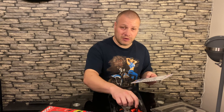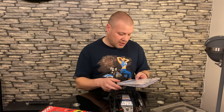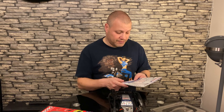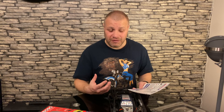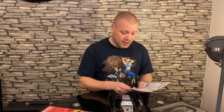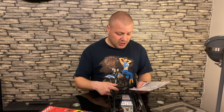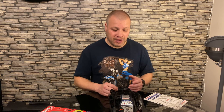In Programme 2, used when connected to any other motorcycle or with the battery removed, you switch to Programme 2. It has: low-volt start, pulse wake-up, test before charge, and then — this is what's different — a save sulfated battery step, which is not on the BMW programme. If you've got a battery that is sulfated and completely dead, you'd ideally want to take that battery off the vehicle anyway and use the crocodile clips to try and desulfate it. Then: pulse save, charge control, optimise, test after charge, and 365 maintenance. So that desulfate step is what you're missing when plugged into the bike — which you won't need anyway if the battery is that dead.